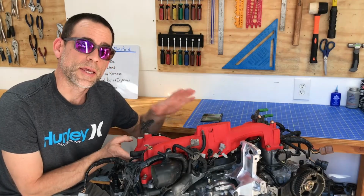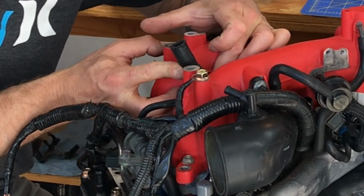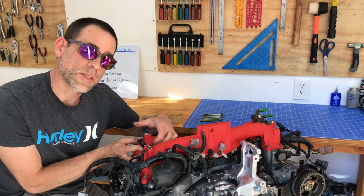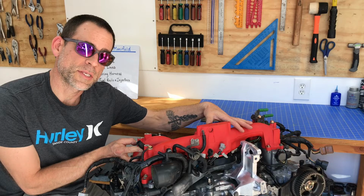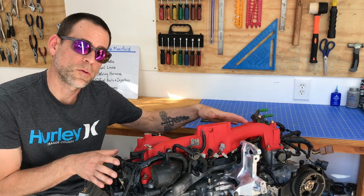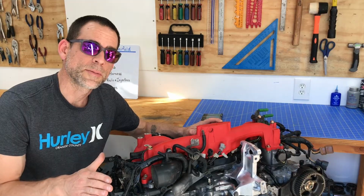And that, guys, is how you get this intake manifold dropped onto this engine. You actually have to bend this hose so it's up vertical slightly, and then you can weave this hose through these 2 runners of your intake manifold while you drop it down onto those gaskets, and then get it lined up with those bolt holes, and then drop those bolts in and torque them down to 18.1 foot-pounds.